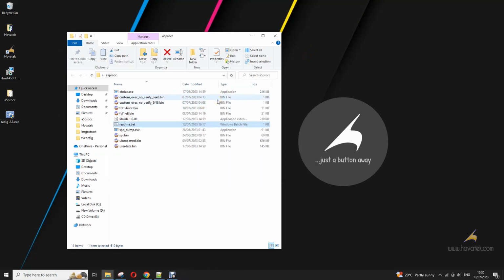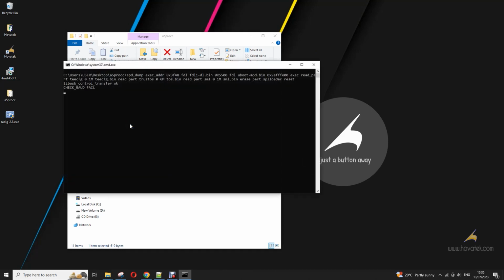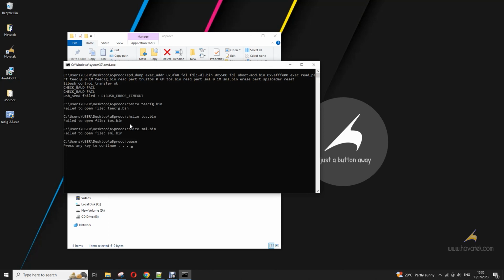Download mode for my device is volume up, volume down, and power button. Some devices on this list, A5 Pro, A5 Pro CC, A7, A7 CC, might be volume down and power button alone. So I'll link to the various button combos for each of these models.